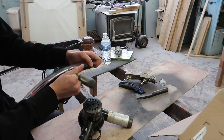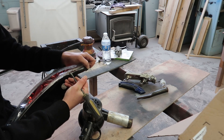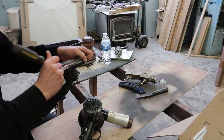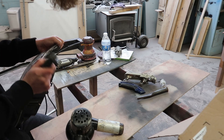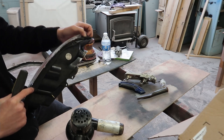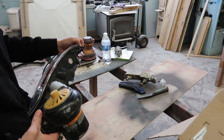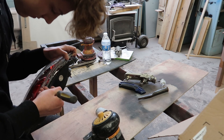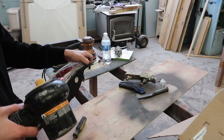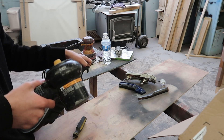There's a little clip right there that we're gonna have to work around, so we're gonna get our screwdriver in there and get it to pop around. There's another one of those clips right there, so we're gonna heat this area up a good bit more than everywhere else and then pop that out. The aim of this game is slow and steady — just taking everything with a good amount of heat and prying it slowly to make sure we don't crack this lens.